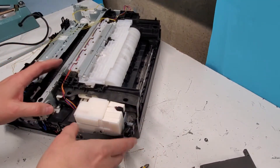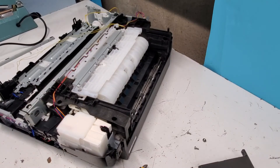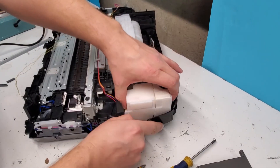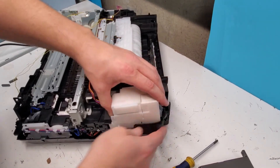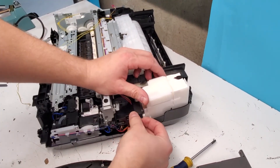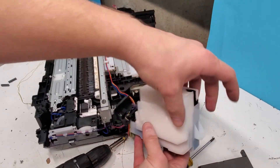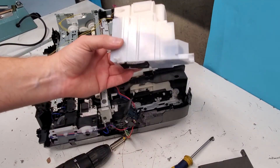This is the ink pad absorber, or ink absorber pad. It has a screw right there on the bottom. To get to it, we're just going to use a screwdriver. I'll remove this tab here. There we go — you can see there's some ink in there already on the side, but it has plenty of room for more ink.